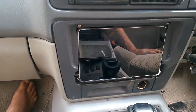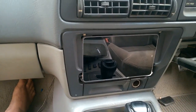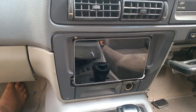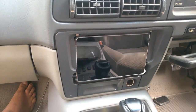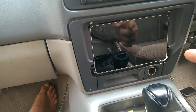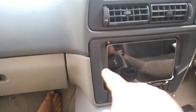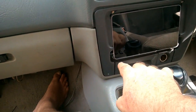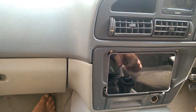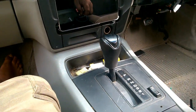Finally finished the Nexus tablet into the dash of my EB Fairmont. It's pretty easy to do - just sort of cut out the fascia as much as you can with a Dremel. Behind it is a USB 3.1 amp twin USB port that runs power to the tablet. I drilled through here to run a 3.5mm cable that runs under here, through the console.